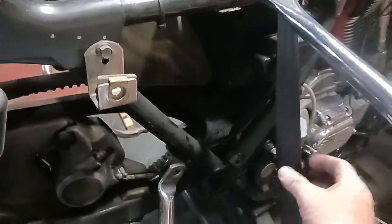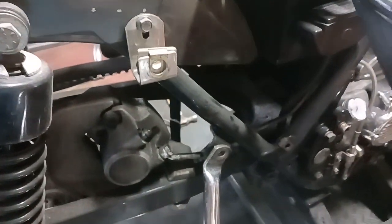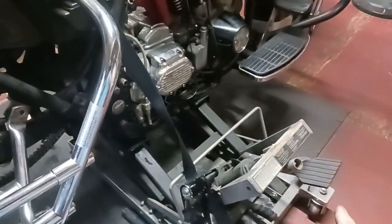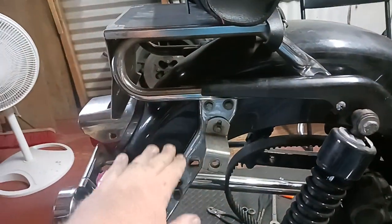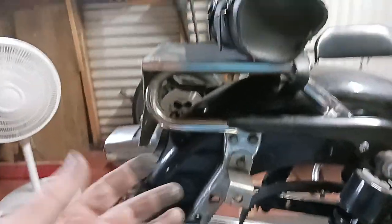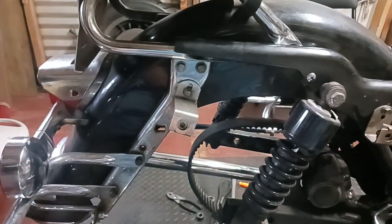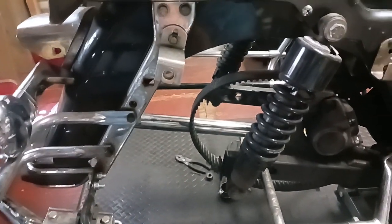Once I got the axle out — I kept my bike strapped down too — I just lowered the jack, then jacked up my bike jack right there and pulled the wheel out. I didn't jack it up too far, just right about here, and kind of turned the wheel sideways and pulled it out. Don't forget to take your belt off when you loosen up your axle and everything.